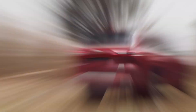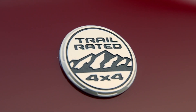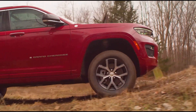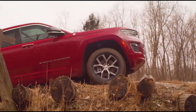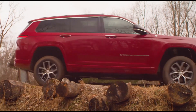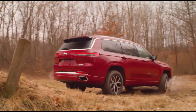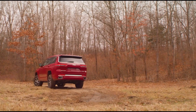There are lots of different tests that we run. We'll take the Jeeps through an array of mud pits. We'll literally get them loaded up underneath in terms of all the suspension components, looking at all the components that have that weight on there — will they sustain? Will the belly pans be pulled off or not? Water-fording as well. We were able to increase water-fording in this car by four inches. We'll take the car through 24 inches of water at five miles an hour, looking at how components are performing.